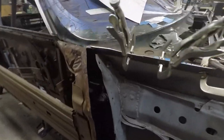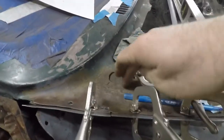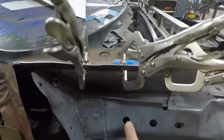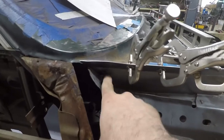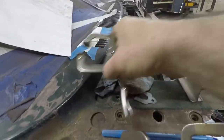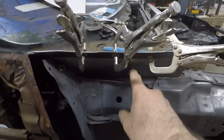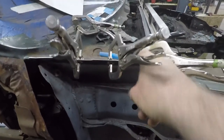We're back on the Pontiac again today and I need to start attaching the Pontiac to the Miata. I needed a close-out panel — it kind of closes this all out and adds structure because this is where the fender bolts on. I made up a couple little pieces, one for each side, just did one and duplicated it on the other side. So that gives some structure there.